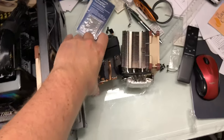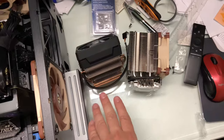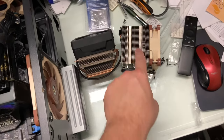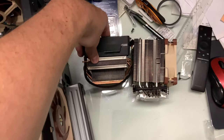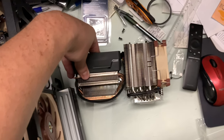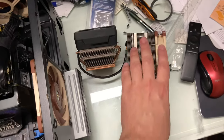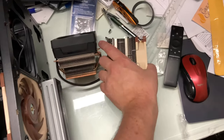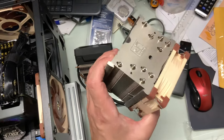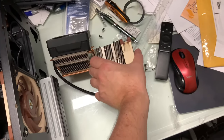Right off the bat, you can tell that it has pretty much double the heatsinks, and the angle of the heatsinks is a little bit different. This guy pulls air from the top, this guy pulls air from the side, so this guy's probably better airflow. One of the things to notice is that we're talking about pretty much twice the amount of metal dissipating the heat. The more heat pipes you have, the more cooling performance you should have. The benefit of it being cooler is that it allows the CPU to also be quiet — cool and quiet.